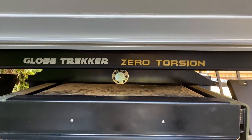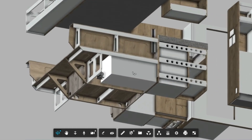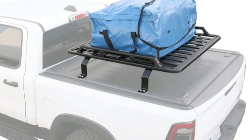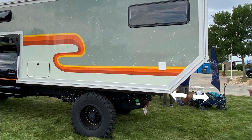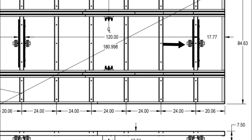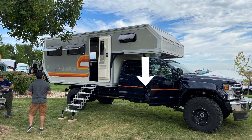Pivot positioning: generally speaking, aft crossmember axial pivots should be placed in the furthest aft crossmember weldment unless you are planning to add an internal water tank or something else that is potentially heavy toward the mid-range of the habitat. The idea is to manage the load. With a truck bed, you want most of the weight over the rear axle and evenly dispersed forward and aft. Mid-habitat weight can be accommodated by moving the rear crossmember pivot forward one weldment crossmember from the rear-most crossmember weldment. Departure angle habitats that already cantilever an additional two feet should not cantilever more than 48 inches from the rear-most crossmember pivot. The forward crossmember should also be placed as far forward as possible unless loading dictates otherwise. In cabover models, the crossmember shall be placed in the furthest-most weldment crossmember due to the cantilevered weight of the cabover overhang.